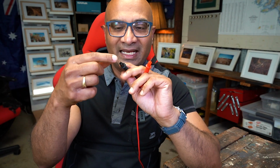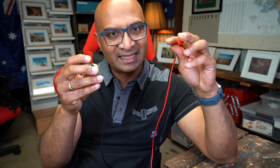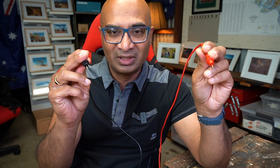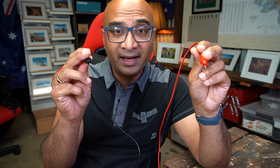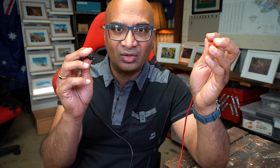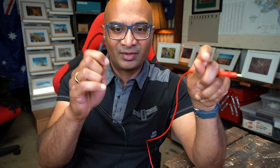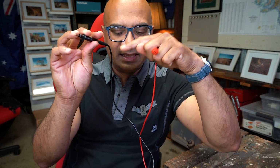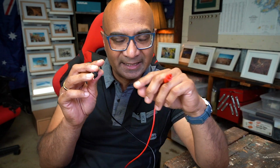If you can just picture this in your mind, get the line coming in and let these two complete the circuit. If you've got your line going through, there's no point sticking this to the same line or the same cable or wire. That's not going to give you much at all. So you need to break that. Take it off and then stick this in. Let your multimeter be the one that completes the circuit.